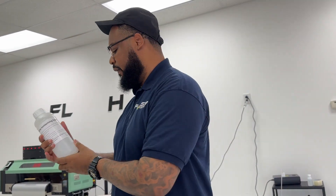So if you guys don't know, our printers have a wet cap solution - that's the old style, the new style is blue. Our printers have a wet cap solution where you sit a little hose down there. You put this down in there and it keeps your printhead wet. We didn't have this printer running for like two months. This solution right here, as you leave your printer on, it stirs the white for you. It auto-recirculates white ink, and if you have this solution in there it'll always keep your cap wet.